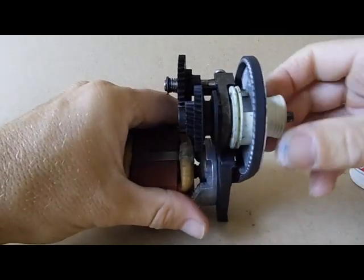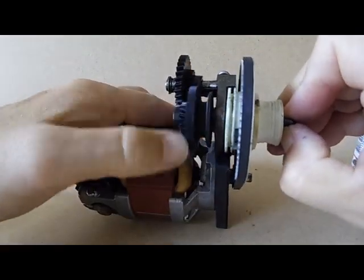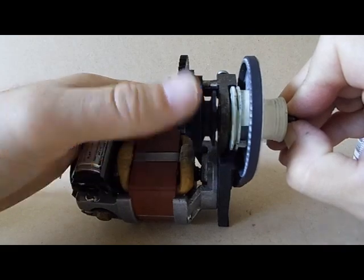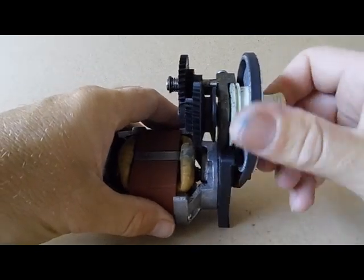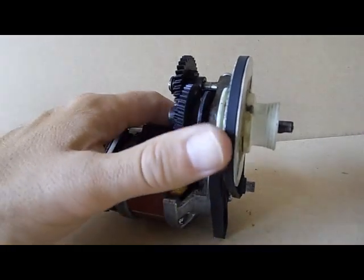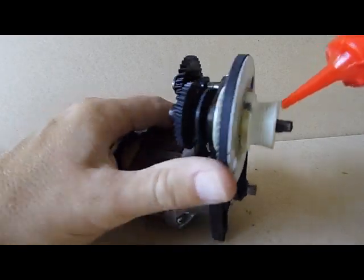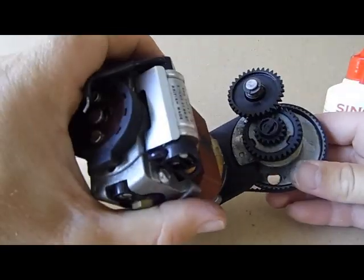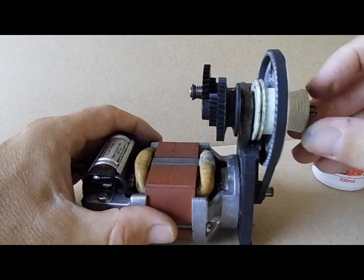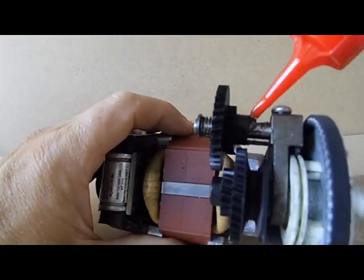Now it's clipped in again and it will work, but this can get dirty. If you hold that in, it runs freely and can't drive your sewing machine. So it just needs a good clean. Normally you can just work a little bit of oil in from this side — obviously you won't open your machine — but sometimes you might just have to really get in there. The same goes for this little gear that slides in and out — give it some oil and a good clean.